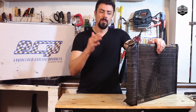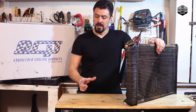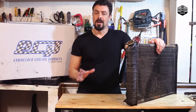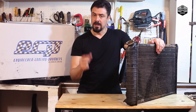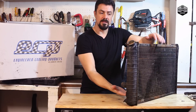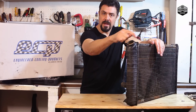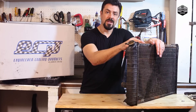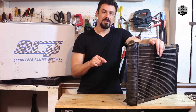Now we're going to go ahead and replace that. Two things to keep in mind: one is the rubber mountings at the bottom of the radiator housing — we're going to have to modify and trim those, leaving them as a U-shape. Second thing is the hood that goes on top, which creates the pressure to keep the radiator in place — we're going to have to cut around the radiator cap area because we're going from single-row to two rows.